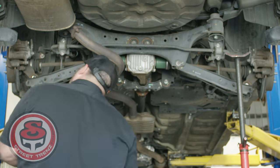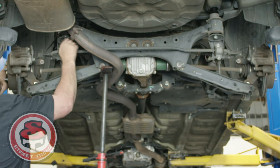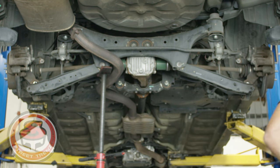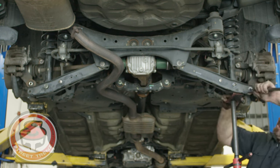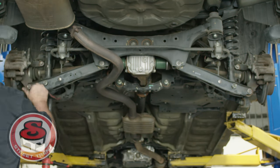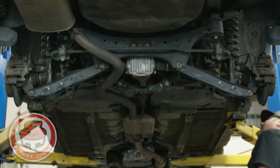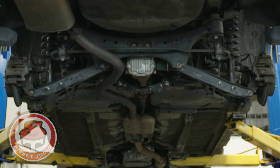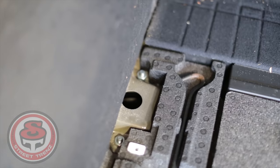He's putting in the spacers — there's the back spacer going in. Tightening up and putting the strut back, putting all the bolts back and torquing everything down. We did have to replace the brake line. He had to make a little bracket to offset it a little bit because it was already pretty tight. I'm going to mention to Subtle Solutions about maybe including or recommending a relocator for the brake line to take some of the pressure off, just in case.